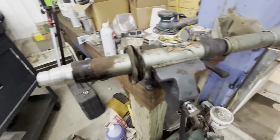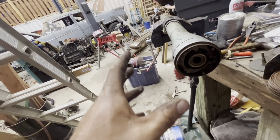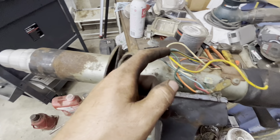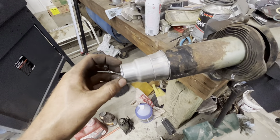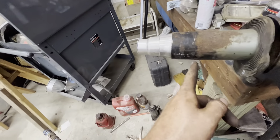I cut off the end of this — that's where the automatic transmission arm, the intermediate column, came out. I cut it off because it was sticking out too far anyway, and there's some sort of rope that goes internally that I'm going to take out or just leave. What I'm going to do is weld this, stick it in as far as I can, get a good bead of weld around there. I'll probably tack weld this bearing in because it sits in there. I'd like to tack weld it just so it never spins — I want just the bearings to spin. They aren't really great bearings, but they'll do the job. It's just a steering shaft.